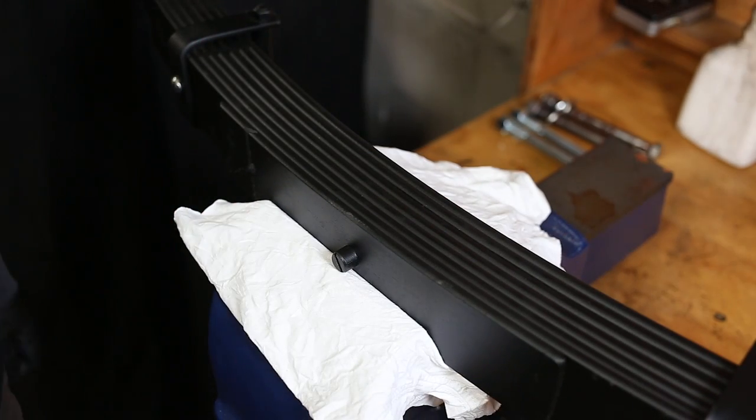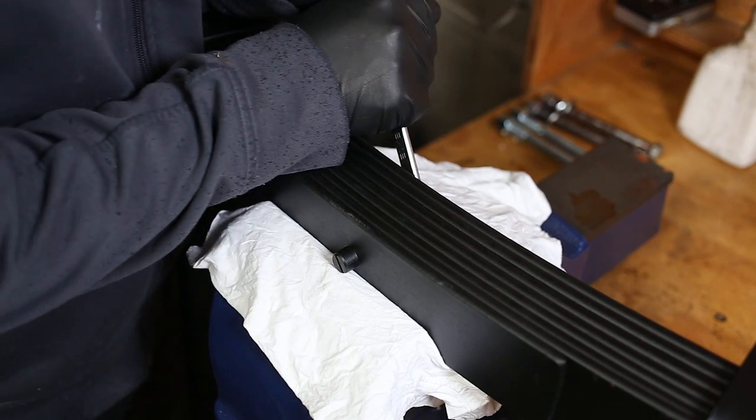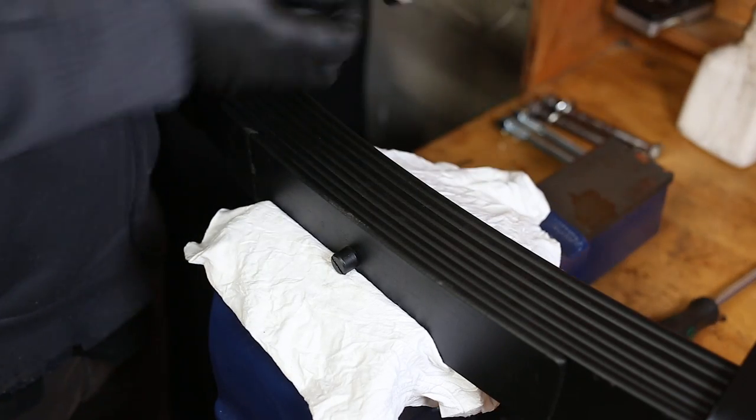And there was a minor issue with those as well. The centre pins have been installed the wrong way round. The round end of the pin is what locates the axle, so it has to be on top. No drama, it only took me a few minutes to swap them around.